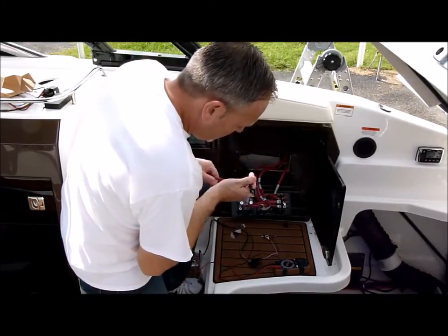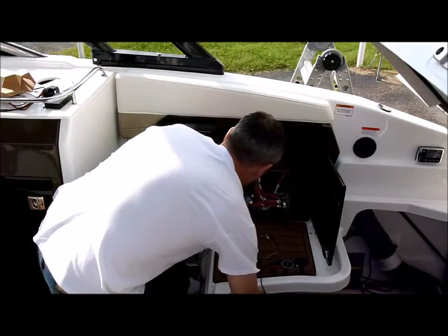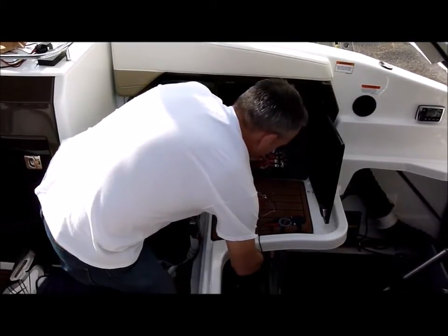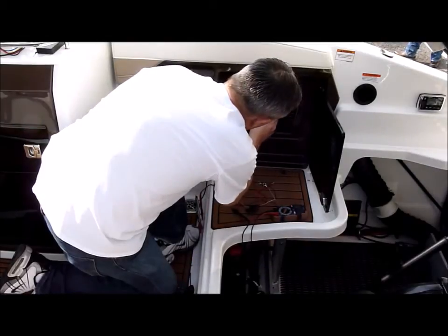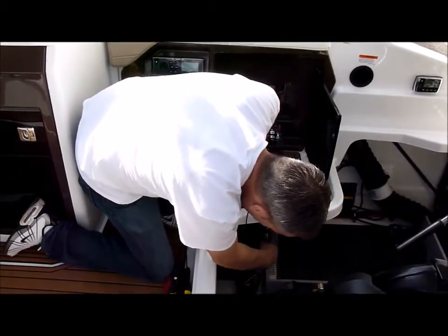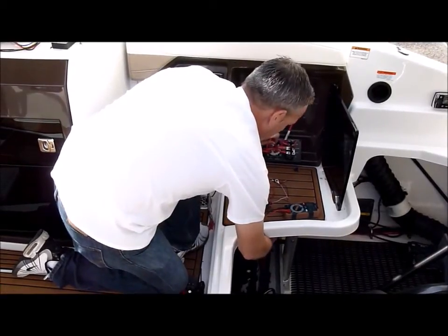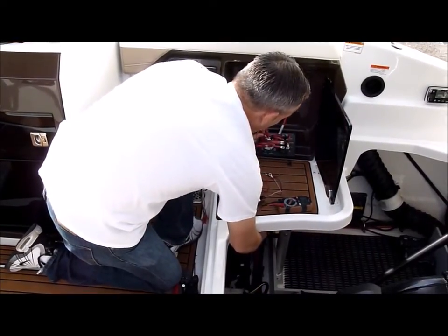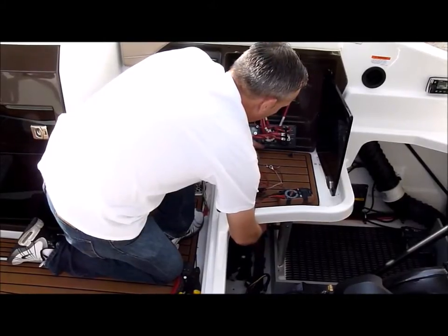Find a ground, and then check to see which one of these are hot and which one's not. So when we have the switch turned off, we can tell which one does not have power to it anymore. The other two leads coming in — if they're not marked — you'll be able to tell which one is battery one and two. In this case, we're marked battery one, battery two.